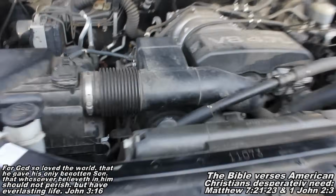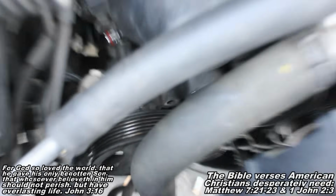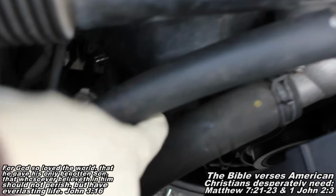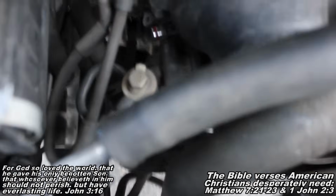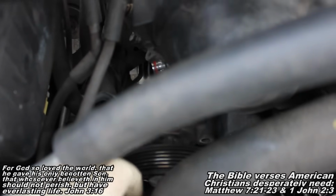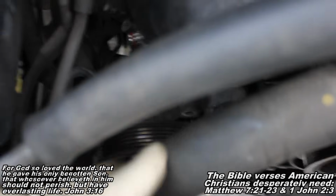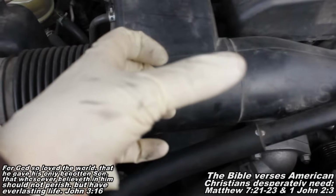And guys, I have found one helpful strategy while putting this guy back together. I noticed it's really tough to get the alternator back up on the stud. That's what you gotta do, is you gotta hang the alternator on the stud and hold your power steering pump pulley back at the same time, because the best way to do it is to get underneath the car and put it up and then just raise it up and slide it over that stud.